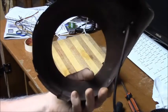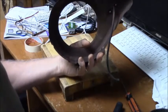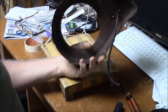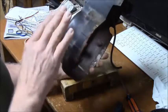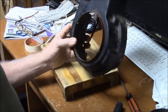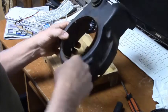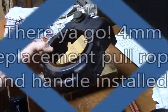So this will work with electric start. And you can buy a 110, 120 volt AC electric start kit for that for under $70. It's in the 60s. So if I get this running right, I might retrofit this because my daughter lives alone and she needs something to do her driveway with. And this small 5 horsepower one will be a lot easier for her to handle. Alright, so all I'm going to do is put this back together with the sheet metal screws, and then we'll start working on the snowblower outside.